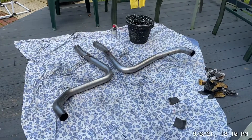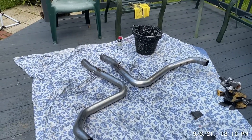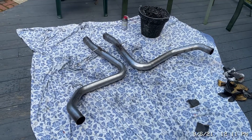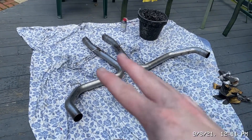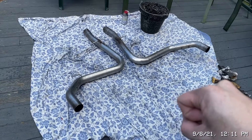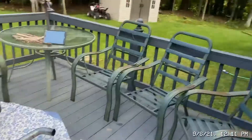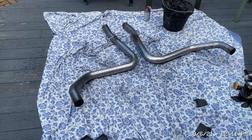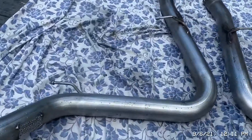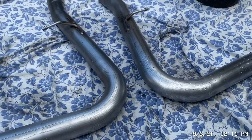William with the blue convertible — the one with all the polished parts — recommended wet sanding with WD-40, and it's good to an extent, but Danny Johnson's water and soap method works more efficiently. When WD-40 gets on here and turns all black, it's like you're sanding through a greasy smear coat — it's hard to grip the pipe and it seems like you're rubbing the black into it. That's why I had to get the dish soap and SOS pad out to clean it off and see what I'm working with. They look cleaner than I thought. I still got a few more stages of sanding to go, and then the polish is where it's really gonna shine.